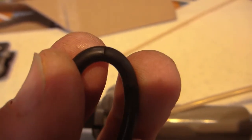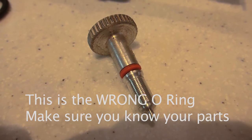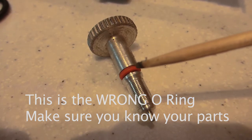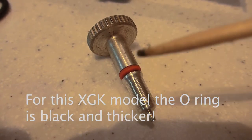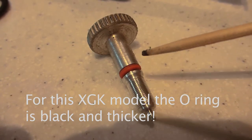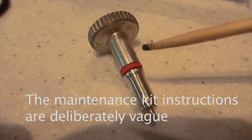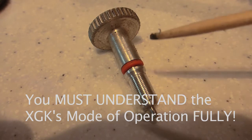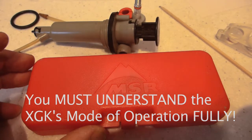There's another o-ring necessary to check — it's on the needle valve, and that's this o-ring here. This is the o-ring which stops fuel passing along the shaft in the wrong direction, so it's got to be in top-notch condition too, otherwise it's a serious problem. When you use these valves to go on and off, never screw them in really hard or turn them too many times — if you screw it in too tight it's simply not necessary and you'll damage the o-ring.